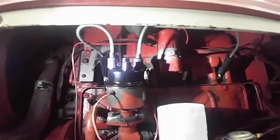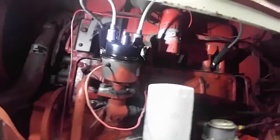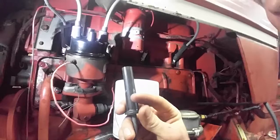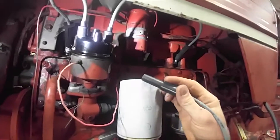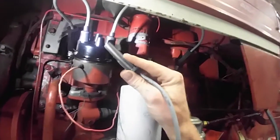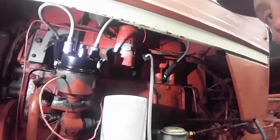Take this piece — the piece that goes on your spark plug is already connected when they come out of the box, thank God, because those would be a pain. Since we're going in firing order, we're gonna do three next, so you just click that on there.